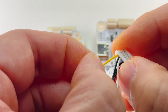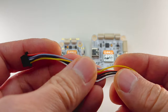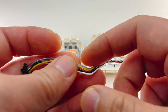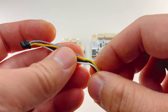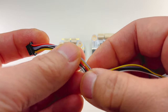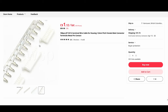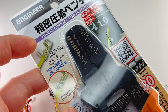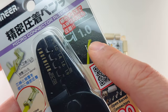Another consideration with plugs on both ends is the fixed wire length from the factory. If you want your quad lighter or cleaner and want to shorten wires while keeping the plugs, you'll need JST SH 1.0 connector terminals and a crimp tool. I picked up a crimp from Amazon by a brand called Engineer that can crimp these micro connectors onto tiny wires.